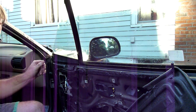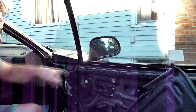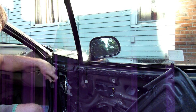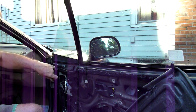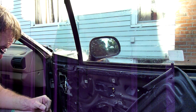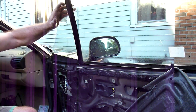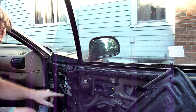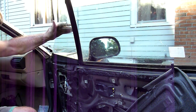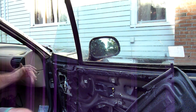When you put it in, for some reason it tends to back away, so you end up having to start with your fingers. If you lose it, it can't go anywhere — it's trapped in this little tunnel. Same thing with this group. You don't want to lose that front one because that tunnel dips down and you'll be in there with your magnetic finder. Put the three bolts in loose, push everything up tight against that window, then tighten them. Now she's locked in place.